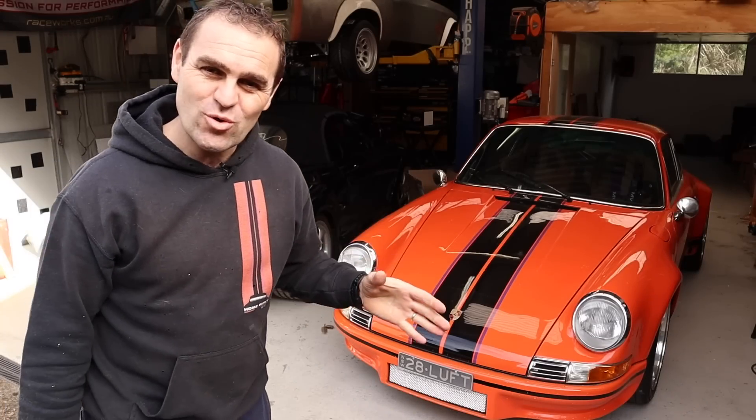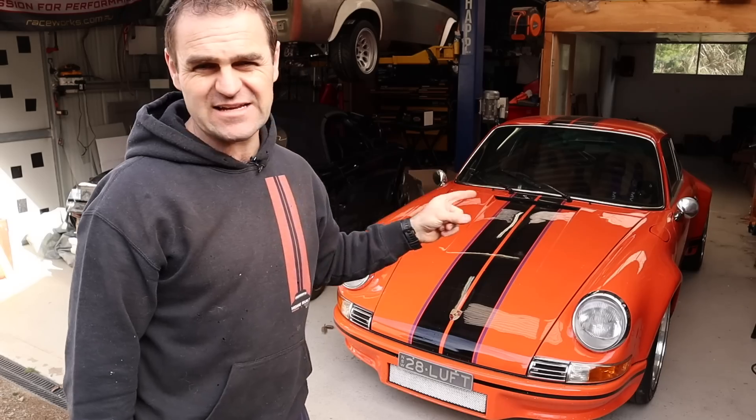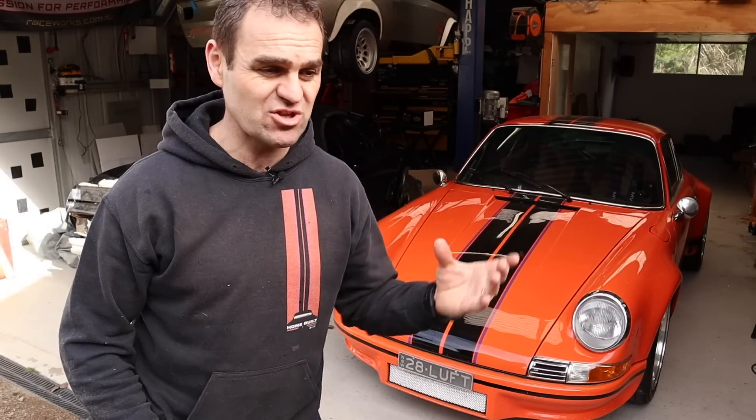Alright, so that's a lot of talking to bring me back to what we're actually doing today. As I mentioned, I feel that this car is restricted at the top end by the headers that are just too small. They're restricting the flow of air at the very high end so that it just can't push enough through, and that's what's making my torque drop off just at the top end.